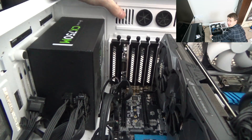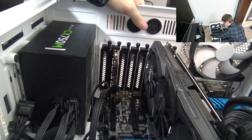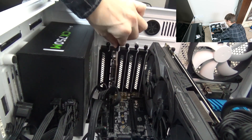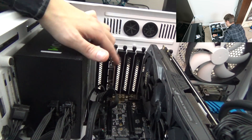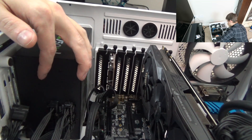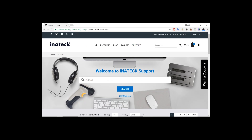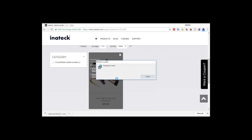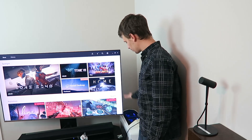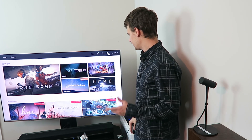With all the cables connected at the back, we're going to plug the two USB 3.0 sensor cables into the new PCIe card along with the Oculus Rift headset, and put the USB 2.0 cable onto the motherboard. Since it's 2017 and nobody uses optical drives anymore, head over to the Inateck support site and download the USB 3.0 drivers. Once the card is installed, the drivers are installed, and you've had your restart, it's time to run the sensor setup again.